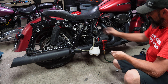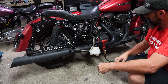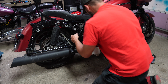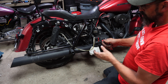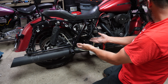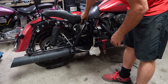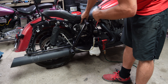All right, so we're done. All I have to do is put things back on the bike and we're back on the road again. An important part of this is you do want to check for leaks anywhere. Make sure that those little crush washers didn't get gouged or damaged in the process, because that'll cause a leak. Got the line installed, got the brakes bled — it should be good to go. But remember, it's going through the ABS system, so if we have a problem or we have air trapped in the ABS, we may need to take it to the dealer to have them ABS brake bleed.